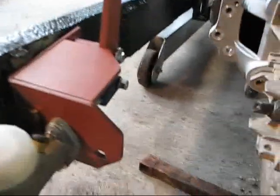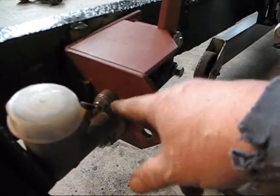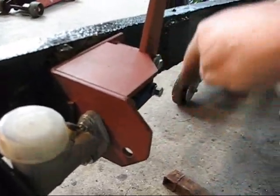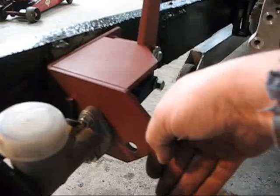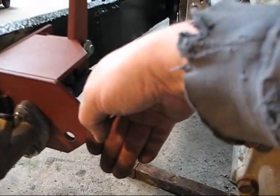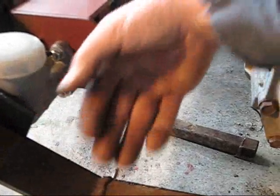This was originally made for the brake master cylinder, but what I did was I took the hydraulic cylinder for the clutch off and mounted it here, with the idea that I'm going to put the other box — I called the guy that built this thing last night and got him to ship me another one — and I'm going to put the brake box right here, which will put it just about the right place the way I had my measurement before, and the cylinder on it will sit back in here right over this motor, this transmission mount.